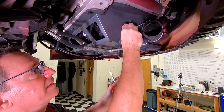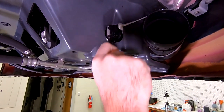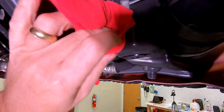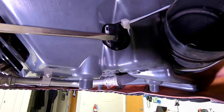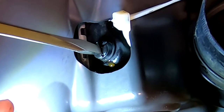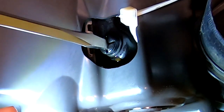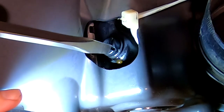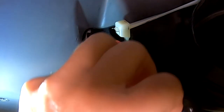I'm finished draining, so let's go ahead and put the drain plug back in. I'm definitely starting this by hand because this is plastic threading into a plastic tank. I'm going to pay attention to that rubber gasket — there is no torque spec on this, but I don't want to crush it so it squeezes out of the space. You can basically see between one turn and the next when it's starting to squeeze out. I'll give it maybe a quarter turn more and call it good, then wipe it off to make sure there's no drip, because afterwards you'll want to confirm no new drips have formed.